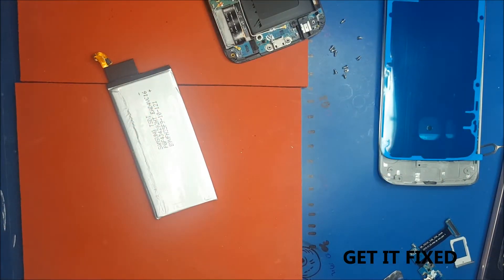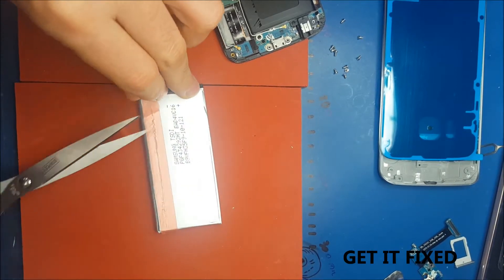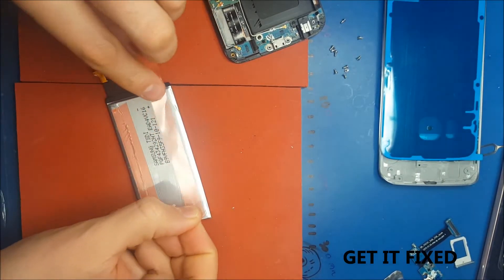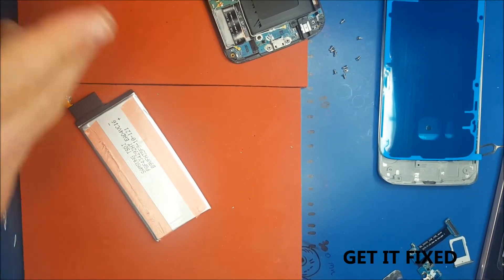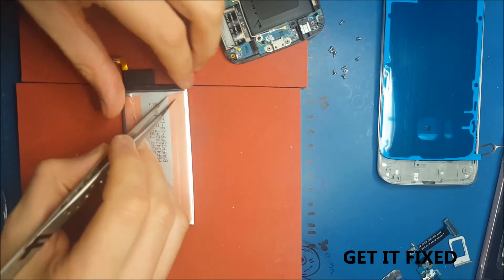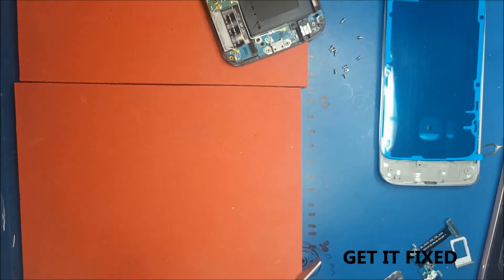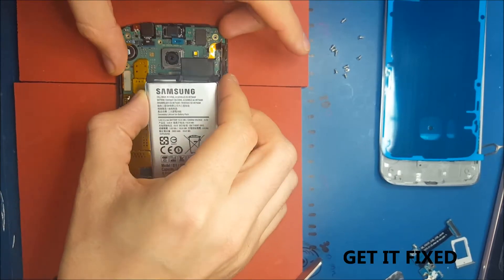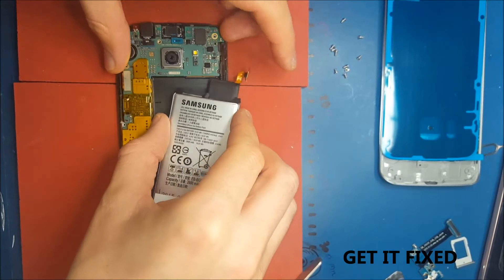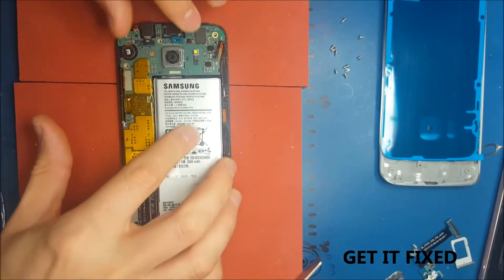So as you can see, in the first video I removed all the tape from the new LCD — the original tape which was for the battery — and also I'm taking off the old tape from the battery which remained from the previous LCD. Because if you leave it there and put new tape, the battery will actually be lifted a bit and will push back into the back cover. So remove all the old tape and just put new tape in there, a really thin one. Don't use too thick tape because it will not align properly with the LCD and the back cover.